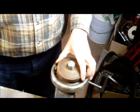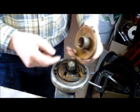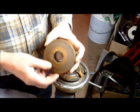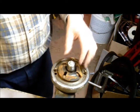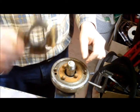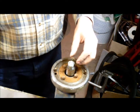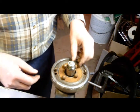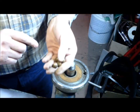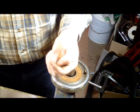Once you've got the fixed cheek off, you're now down to the point where the movable cheek, unless it's very, very rusted, will come off. It's got to be more rusted than this one to not come off. Taking the movable cheek off will get you to the guide. Lucky me — a four ball guide. That's a handy one to have; most of them are only three balls. And here are the lovely little bearings for the balls. For the variator, they all weigh approximately 10 grams — I've had them on the scale so I know.